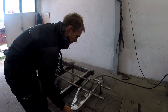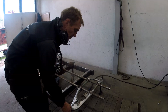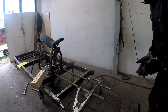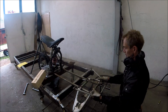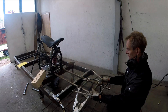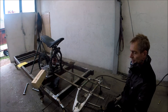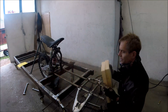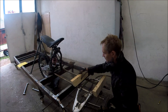The rear wishbone is in position. Now I'm going to try to get the geometry correct because I'm using the steering rack from the snowmobile, and I don't want to have bump steer or anything strange. So it's going to be kind of tricky — I'll position the upper wishbone first and then try to get the steering rack in position.